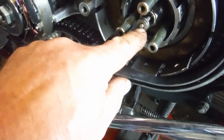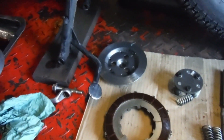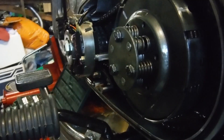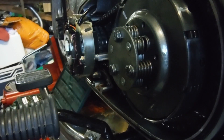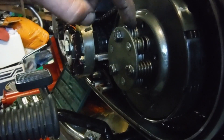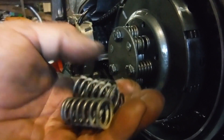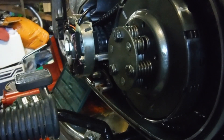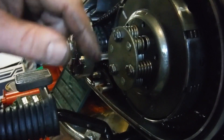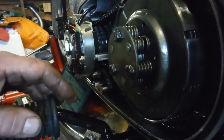Maybe I'll be able to sort it out without worrying about the push rod, but the next part of the job is to make sure the clutch plates are true and get them back in if all is well. After much fiddling and juggling around with various different springs and even some copper washers to use as spacers behind various springs, I've got five of the six original springs out of the clutch and a selection of various other springs of varying strengths, all arranged in a manner that allows for even pressure plate lift. It took a while, moving them around and swapping from one type to another.